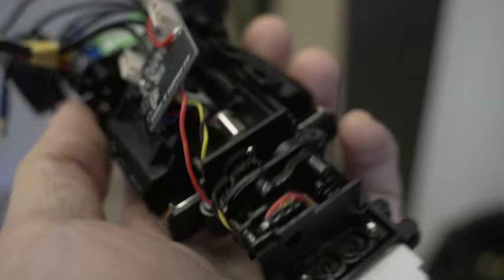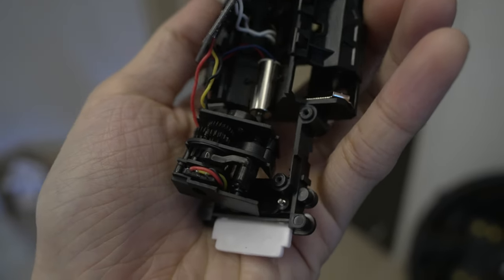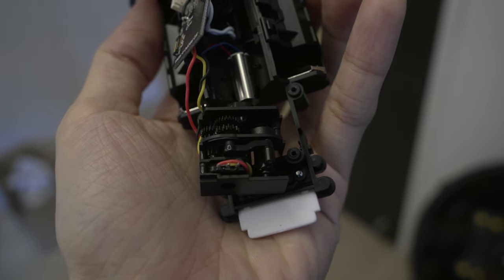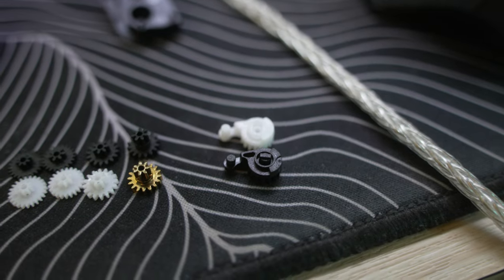The first to fourth servo gears seem to be the same as the MR-03, but when I installed them, the gear mesh seems to be too tight and it wouldn't move smoothly, though I've seen some people on Facebook claim that they were able to get it working fine.